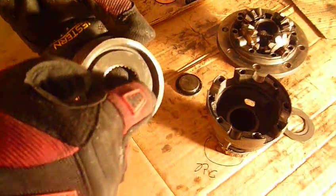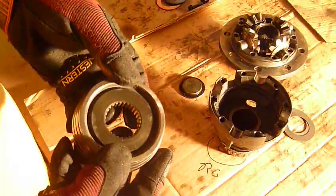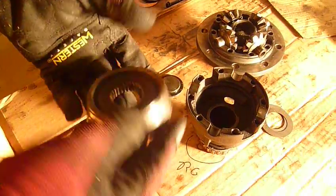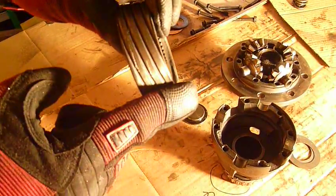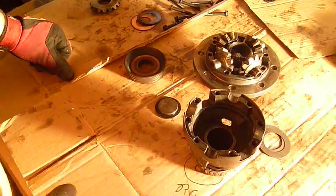You'll see huge grooves right here and huge grooves in there, and that can actually trash the carrier and the cones. If you catch them before that, you can easily machine these back and they're good to go. After you machine them, there's less friction surface, so they will wear out slightly faster. But that's one of those prices you just have to pay.